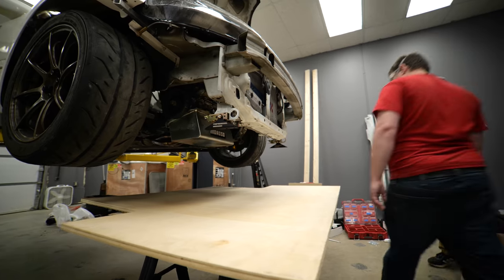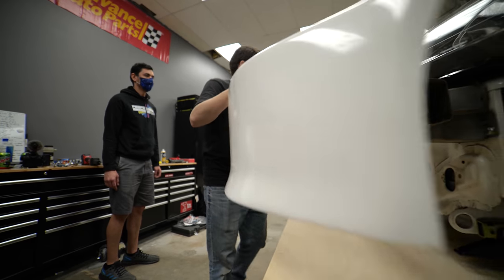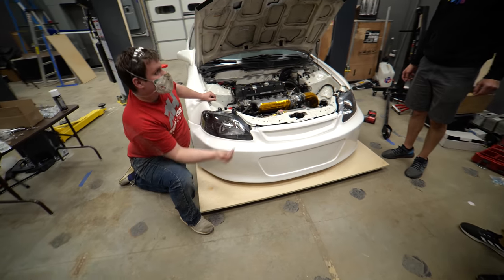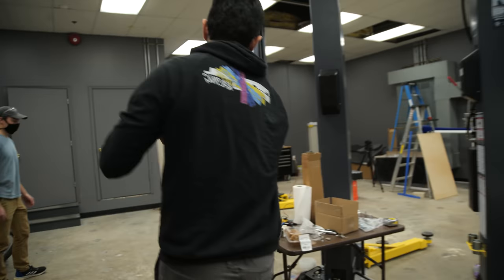Generally, load would be provided by mass or weight — the vehicle's weight. What aerodynamics allows you to do is make load through downforce; literally, the atmosphere is pushing the car downward. When you're able to do that, you have load on the vehicle without the added mass and inertia. When you go to turn, you still have good load but without that added mass, which is just the best thing in the world. Realistically, that's what makes speed — it allows you to go through corners quicker and brake harder. It can also decrease drag, so there are very few downsides.